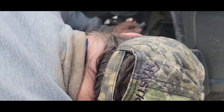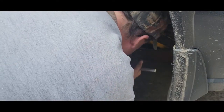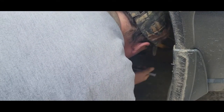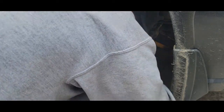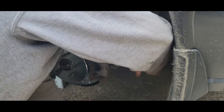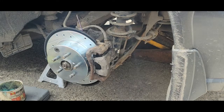I'm sure there's a torque setting but we're not going to check it. I just want them tight enough — some people get carried away and slam them. This pin keeps sliding and turning so I'm going to grab a wrench. Looks to be about 15 or 16mm. I got an Evercraft 17mm here — I'll fit it over the inside and confirm they're tight enough. I'm surprised they don't use a lock nut or lock washer.